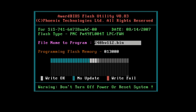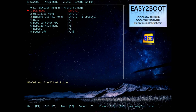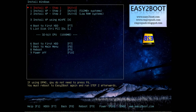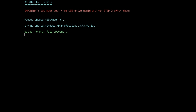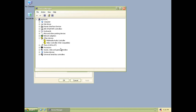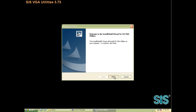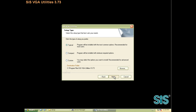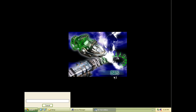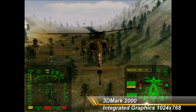The first thing I did was flash the latest BIOS, which you can get from the HP website. I booted off a USB floppy drive and the BIOS flash started automatically. Next I installed Windows XP using the Easy2Boot project — I did a video tutorial on installing Windows XP from a USB flash drive. I then installed drivers: Windows XP detected most devices, but I also installed the AGP chipset driver, the SiS graphics driver, and the Realtek audio drivers.